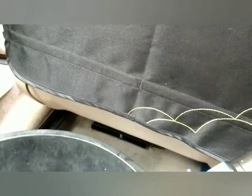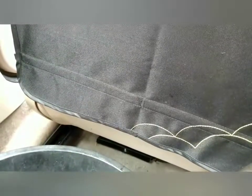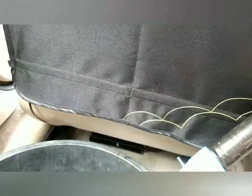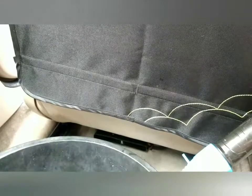The carpets are sopping but it's only in the back passenger footwell. I know there are issues with the plenum chambers and it could also be the sunroof where I'm getting the leak from. All the other footwells in the cabin are dry - it's just this back left passenger footwell that was sopping. I've dried it out and I'm going to put a couple of socks filled with cat litter under the seat, under the carpet, under that black footwell vent.